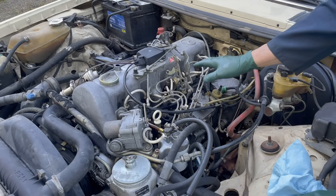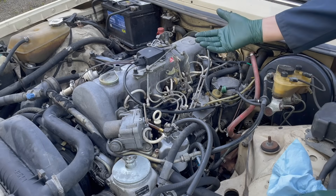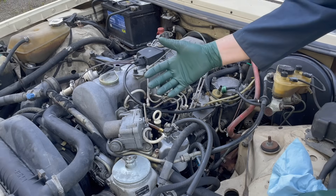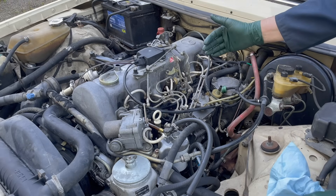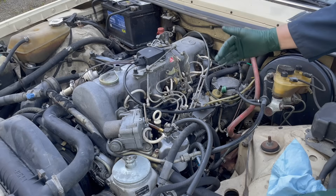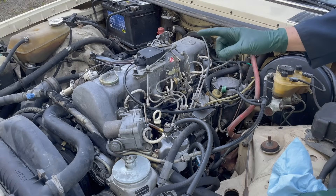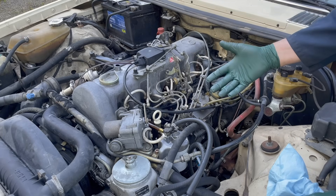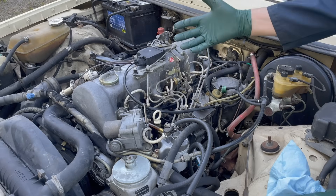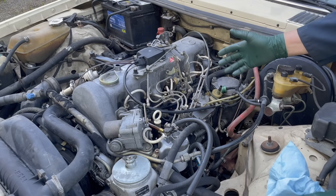In this case the knocking sound is pretty consistent. At this point about the only thing I can do next is remove the valve cover and see if there's any noise in the valve train. This isn't looking very good. So in the next video I'll report back and see if we find anything else on this engine that makes it worth saving. I originally bought this car hoping I could get a good engine to put into another undamaged 123.